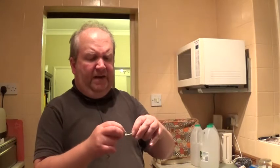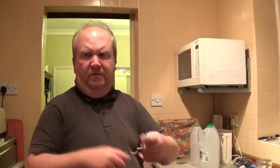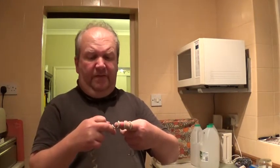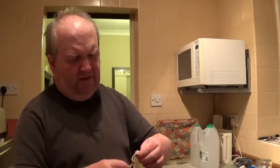Now, when these cords are made, the way that they're made is they start out as a straight cord, which they wrap around a metal rod, like I'm wrapping that around my finger. They heat it up and then pull it off the rod and it's partially curly. But the way they make it a tight curl is they then force the curls to wind the opposite way. And when they force them to wind the opposite way, they curl tighter. So what we're going to do now is we're going to force these curls to wind the opposite way. So these now curl tighter.